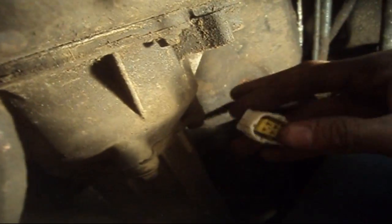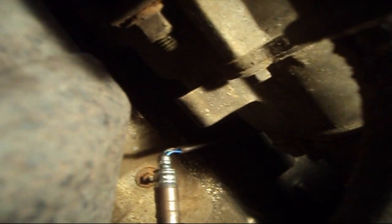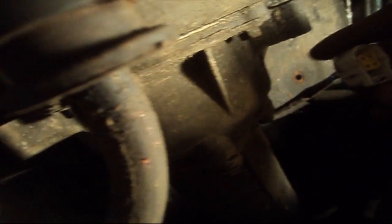What I did here is feed the wire harness to the other side of my transfer case — that's the way it was on my vehicle — so the wires are nice and uniform, not all twisted. I'm going to take this little coated cover and feed it down so it is actually covering the exposed wires. You really don't want mud, crud, and corrosion getting up in there, so I'll probably put a piece of electrical tape there so it is fully covered. Just feed the casing over top of that so the wires aren't exposed.